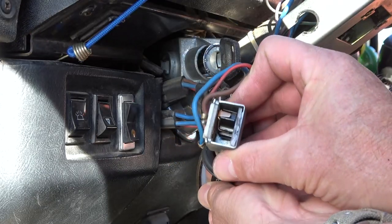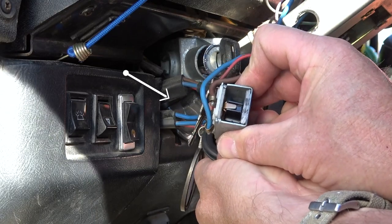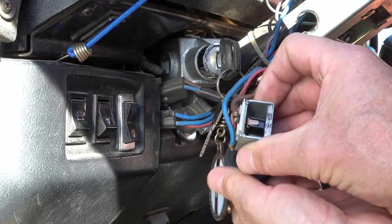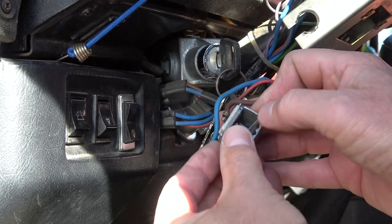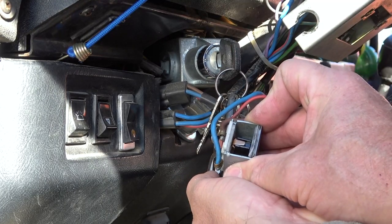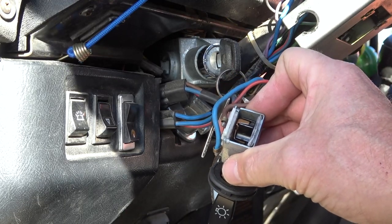The problem is this thing moves in here. As you flick it into the marker lights and to the headlights, main beam, that little plastic thing moves over some ridges. In that little plastic molding there is a little ball bearing on a spring, and the ball bearing puts pressure so that when you move it to the middle the ball bearing comes down into the groove and it will sit there for your marker lights. If you move it a bit further, it flicks over the ridge and into the other groove. In that way you have three positions: off, markers, and headlights.